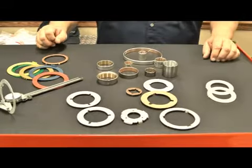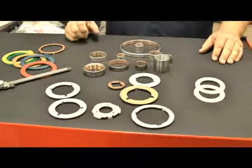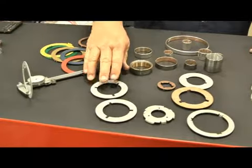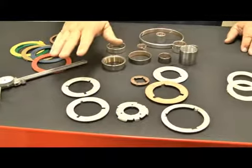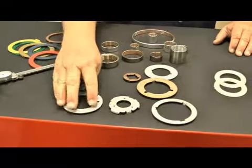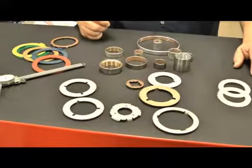The first thing I'm going to talk about are the washers. The washers separate different items within the transmission that rotate either together or sometimes in opposite directions. The washers are much like the bearings within your engine — they're actually made of a very similar material, a Babbitt or bronze composite material. One of the jobs that washers do is they absorb all the metal particles that float through the transmission and get embedded within the washers. In the process of their lifetime, they do wear down also, because they're rubbing against another rotating object.